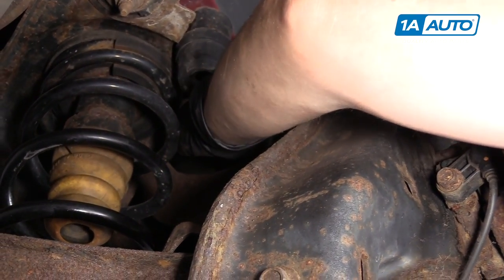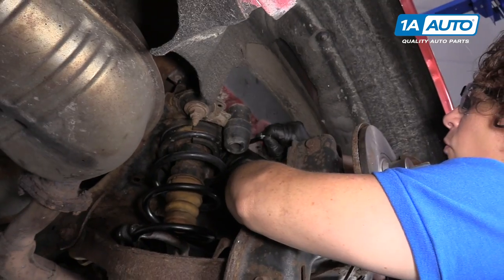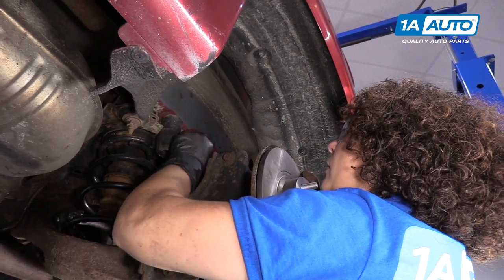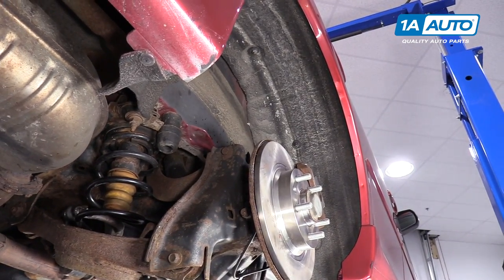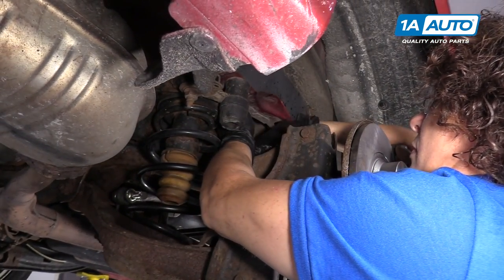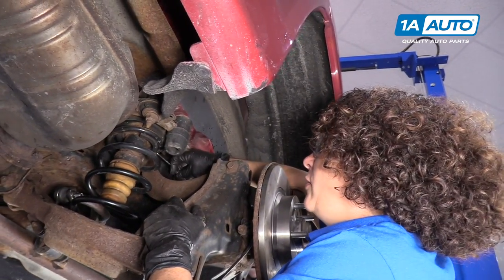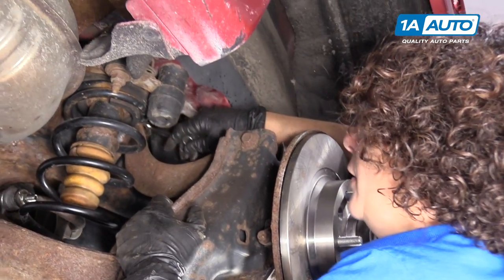You want to undo the top of the shock first, not the bottom main bolt. You'll be tempted because it's right out in the open, but the suspension will drop down — it's better to do the top so that the tension off the suspension goes down slowly instead of putting strain on that bolt. You have to do it in reverse: put the bottom on first, then put the top shock mount bracket on. This one last bolt does take some time due to the fact that you have to use a hand wrench. The ratchet wrench can only be used so long before it bottoms out on that upper control arm bushing and your wrench gets stuck up in there.